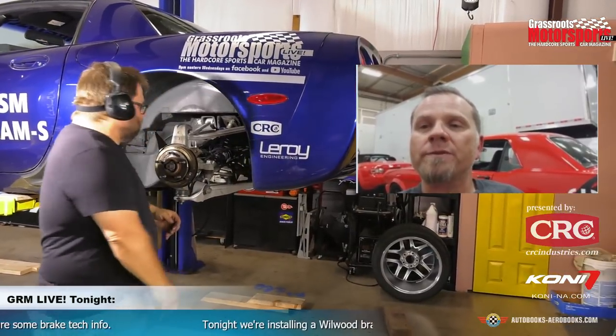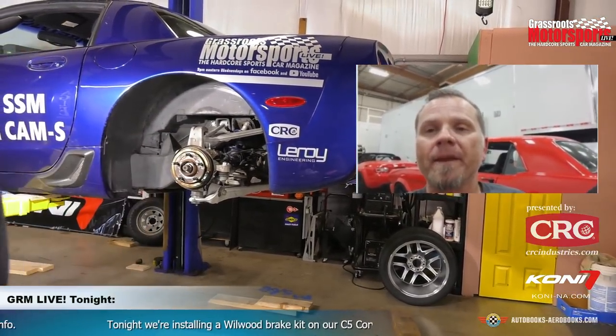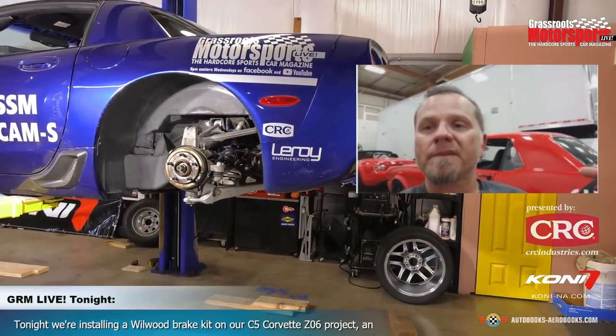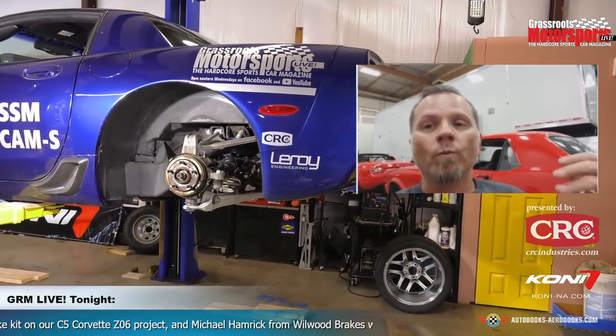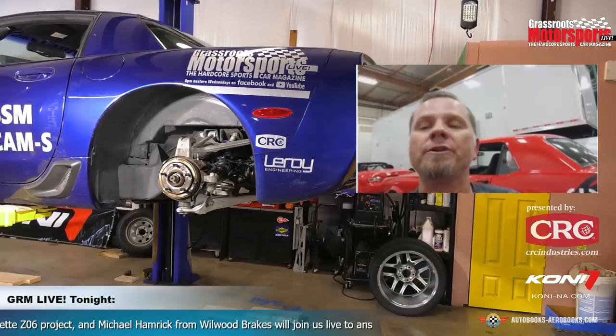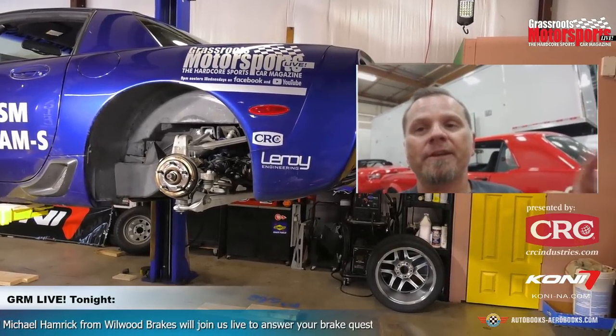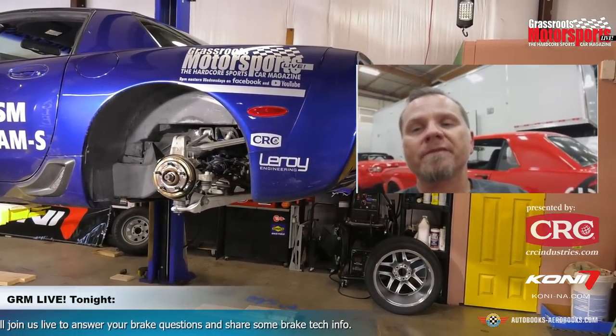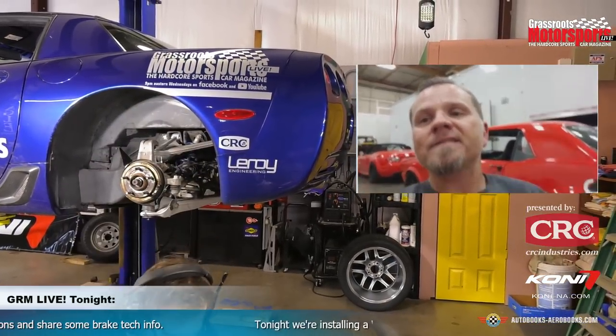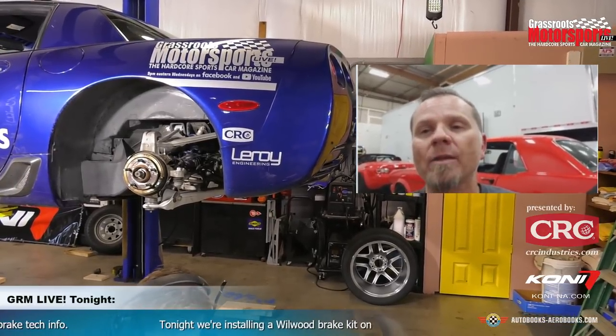I know for a fact that we use our Aero 4 piston caliper on the back of that car, and I believe we use a 1.100 thick rotor, whereas in the front we use a 1 1/4 thick rotor. Because we're doing much more of the braking with the front end of most of these cars, not all cars but most cars, we're going to want better thermal capability in the front than we do in the rear. On your particular application, Danny, we have to go with a 14 1/4 inch rotor because of the way the rear trailing arm or upright spindle is designed. That is the only diameter that we're able to fit our caliper to with a radial mount bracket.